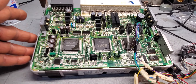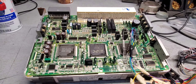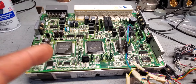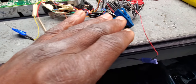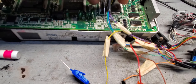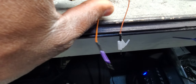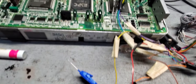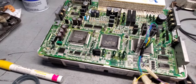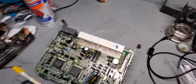From the dealer, when it's coming, that chip is coming ready to take information — like an empty. As soon as you put any key, it will write down that key. So right now we are trying to read this. There are a lot of tools to read with, but sometimes I'm getting glitched. So I get these hooks, as you see here, and I put them one by one with a number on each. I'm going to connect all of them and then use Easy Flasher with this connector to read it and reset it.